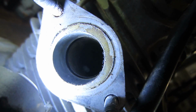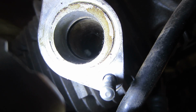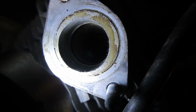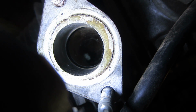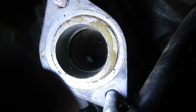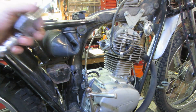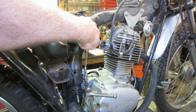There you go. You can see that little bitty. One little bitty in there. So I believe the valve is closed. So I'm gonna go again, like I said, compressed air will blow out, see if we can get anything out of that intake before we try turning that motor over and have it get sucked down in there. You can get that out of there. There it goes.